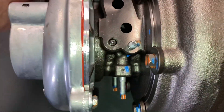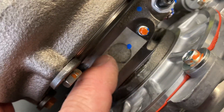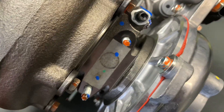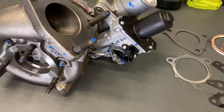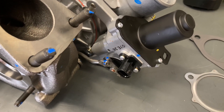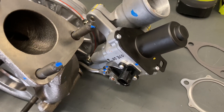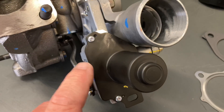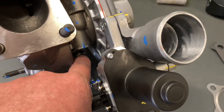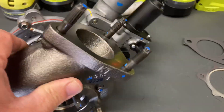Just want to point out - don't forget to remove that piece of tape before you install the gasket and the pipe. Don't just think that's all normal and part of the gasket. There's lots of companies these days selling these for around 400 bucks or something, but everybody I've ever heard of who's replaced just that part - it's turned out to be a waste of time. If there's a problem with a turbo code, it's more related to the mechanical part not being able to work, which is why if you've got a turbo problem it's most likely going to need a whole turbo.